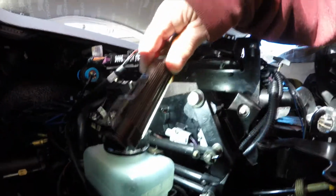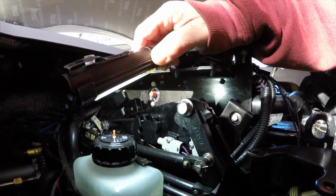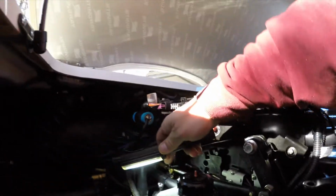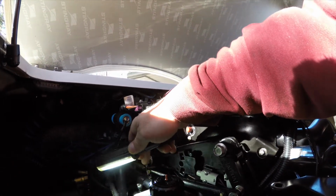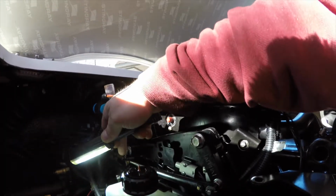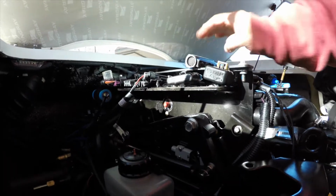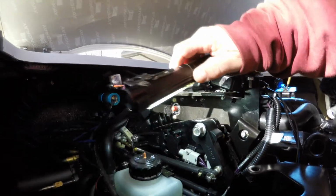And then he said it was doing okay in forward gear, but not in reverse. So that's full reverse. See how it's on the other side? So yeah, I think the cable is just a little off adjustment. So we got to take that pin out over here, and then I guess this comes out of that barrel, and then turn that barrel until this is in the middle. That's the first thing I'm going to do.